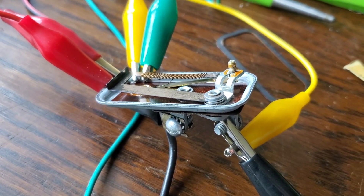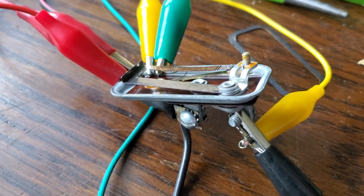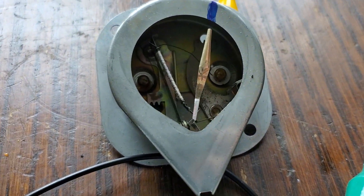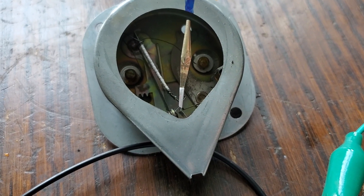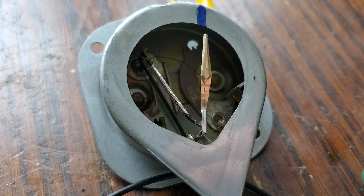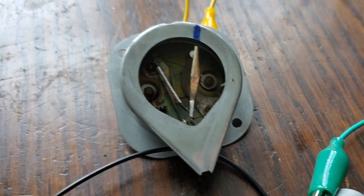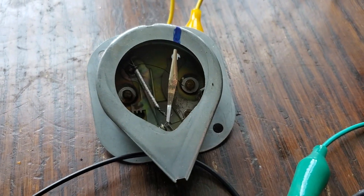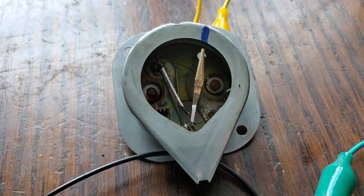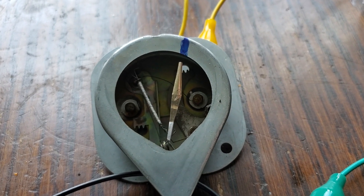This is a switching regulator, but unlike modern switching regulators which switch at, say, 100 kilohertz, this one's more like 2 hertz. So these gauges, instead of just reading as a straight voltmeter or ammeter, instead use a wound heating coil which provides a lot of — the technical term is low-pass filtering — but in other words, it just smooths out that high and low voltage spike, because this gauge is never getting exactly 5 volts, it's only getting an average.